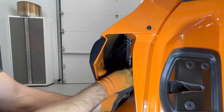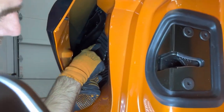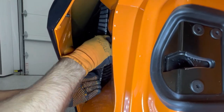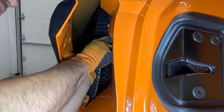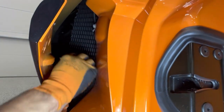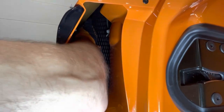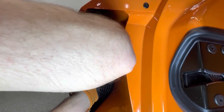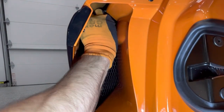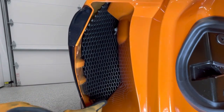We're putting the grill into place here. We're going to go about six hexagons down — one, two, three, four, five, six — that's going to give us our starting height. We'll reach our hand in the back, get this tucked up and under behind this body panel, then start reaching into that taco. We've got our left hand around the tabbed area, our right hand around the three-quarter point — pushing in the middle and bringing that top tip forward quite a bit first.